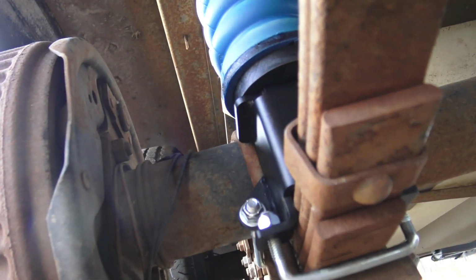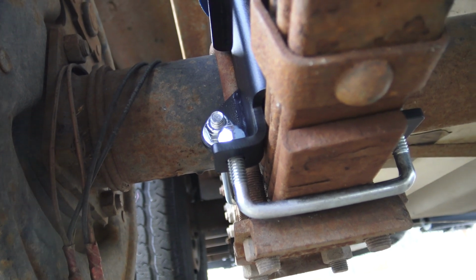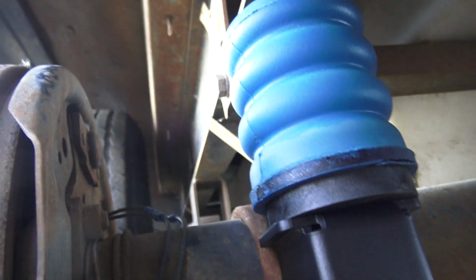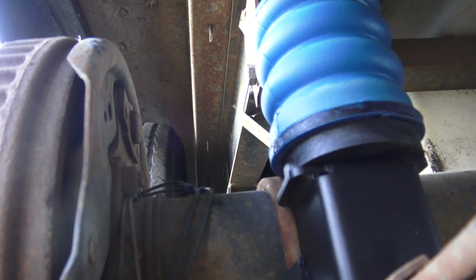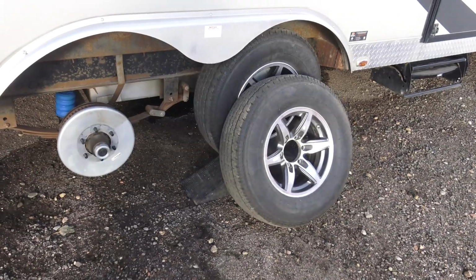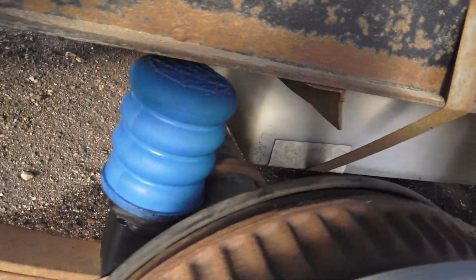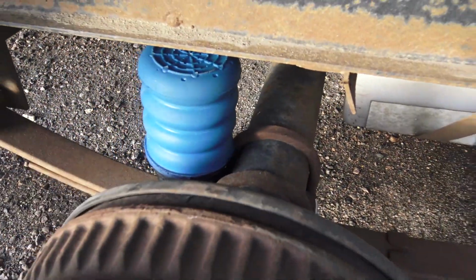Now for these bottom bolts, the bolts that hold it forward and back, you're only supposed to go up to 60 pounds. They are locking nuts, I mean. So you want to do about 60 pounds on your torque wrench. The one bolt that goes to the middle holds a sumo spring. It has that Loctite on it, so that's what keeps it from ever coming loose. And there, I just finished the back axle. So that's on and attached. And that's cool.